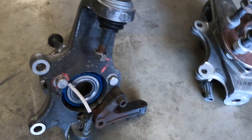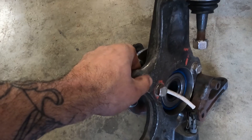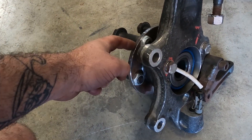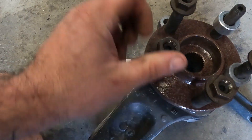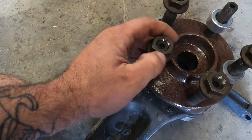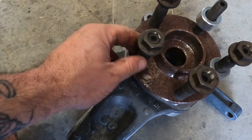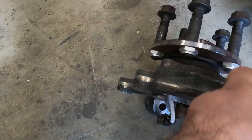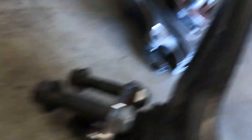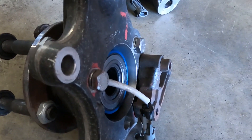This is going to be the magic trick about making the all-wheel drive work. These are just plain Jane Corvette spindles, and I put rear Corvette bearings in the front - they bolted right in. To make sure we're going to handle the power, I upgraded the studs to these bigger race car studs, which will drill the wheels out. These are actually going to be shanked in the wheel itself - kind of drag racing stuff I converted over. They've been sitting a while, a little rusty, but it's going to work great. So we have updated studs, rear Corvette bearings, and a front Corvette spindle.